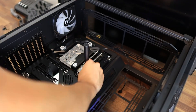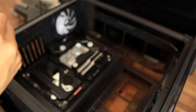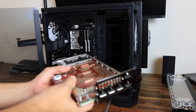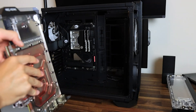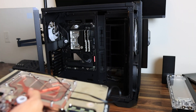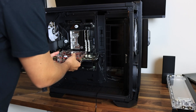After cleaning the case I screwed the motherboard into place — this took me longer than I want to admit as I was using the wrong screws. One of the main reasons I decided to change the build was because the GPU was too wide. Once I installed the active back plate water block it didn't allow the case covering to close — I had the Lian Li O11D. So before continuing with the installation I wanted to make sure it fit, and luckily it just barely did.